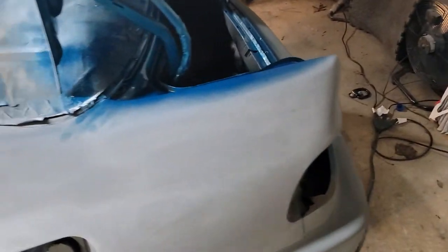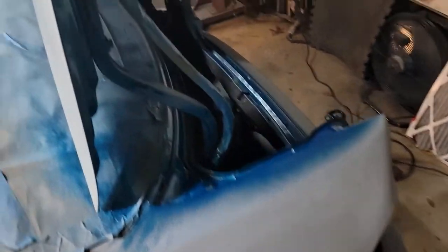I'm gonna get ready to spray the body. I'm about to open up the tack cloth now. I don't want to get spraying the body before any of that dries. Otherwise I just have to let everything dry, sand all those areas, and then spray them.